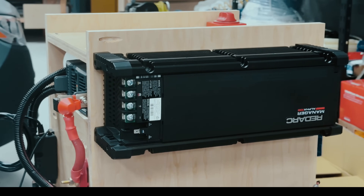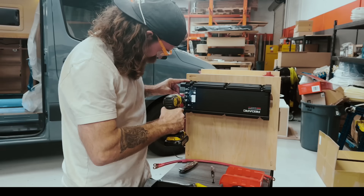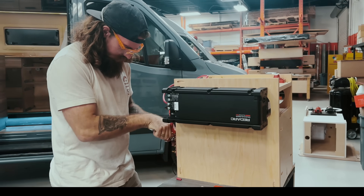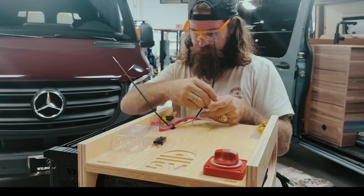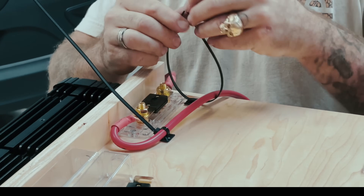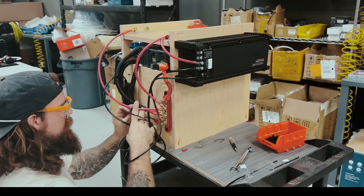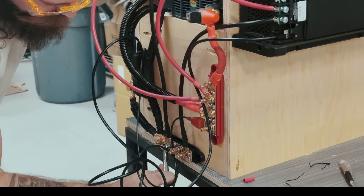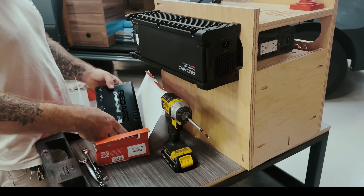The Manager Alpha is the simplest battery management system on the market. It's also what basically makes this an all-in-one system, simplifying the wiring you have to do and the pieces you have to buy. It's a DC-to-DC charger, a battery isolator, a 240-volt charger, a low disconnect controller, a battery monitor, and an MPPT solar regulator. It has a connection for shore power charging — meaning this will provide you a way to charge from all three options: your alternator, solar, and shore power, or an AC plug. Combining this with the TVMS and inverter is essentially everything you need.